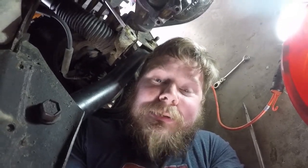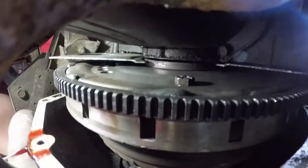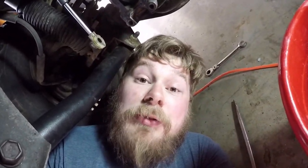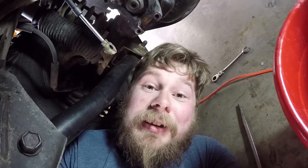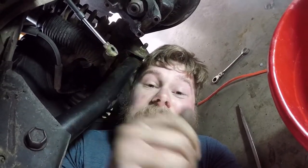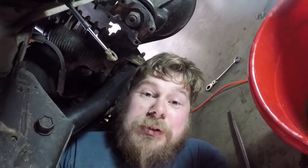Thank you. So we made a mistake. We will own the mistake. Make sure you remove the torque converter bolts out of the transmission before trying to remove the transmission, or you're going to pull the torque converter with it, which is now currently pissing out fluid. So those 4 bolts. Yeah, so now we have to spin those 4 bolts off and then take the torque converter off. We have to drop the trans, put the torque converter back on.